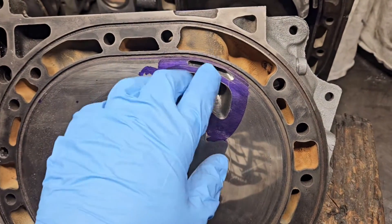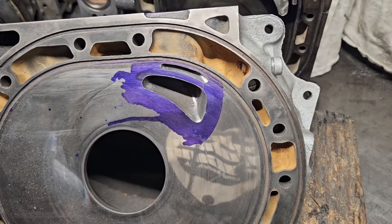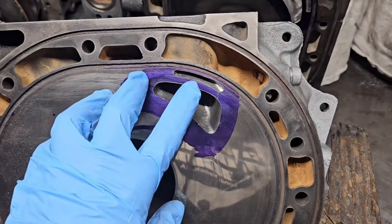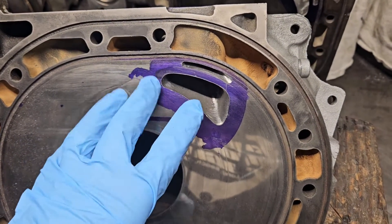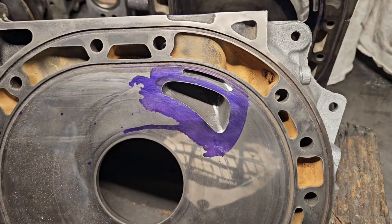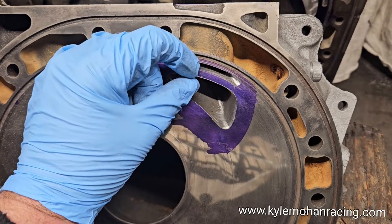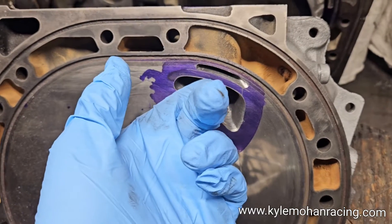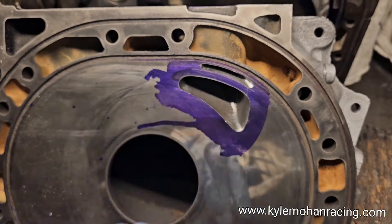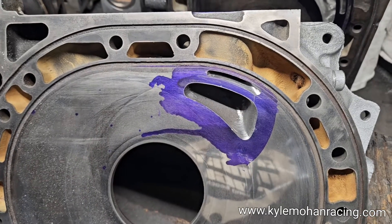Now with a turbo motor, you can just go straight down through and sometimes I do that. The efficiency is a little bit different because with boost, you're just really ramming it in there. But with naturally aspirated, way more important. But either way, a lot of times even with the boosted motors, when we're trying to optimize or maximize horsepower, squeezing a little bit more opening volume by narrowing up the bridge or giving it a proper angle in can help maximize volume and efficiency.